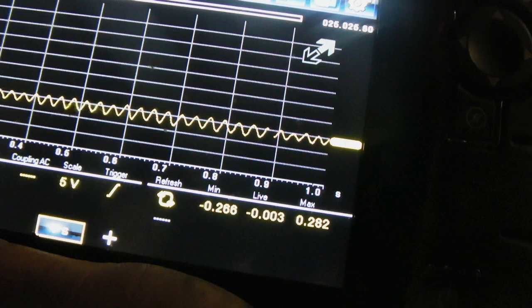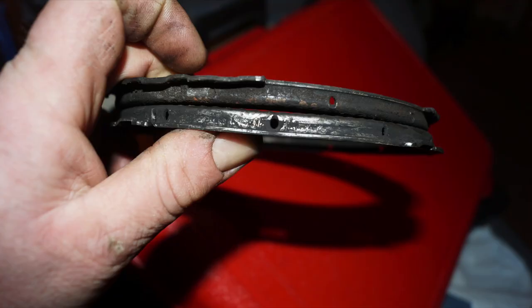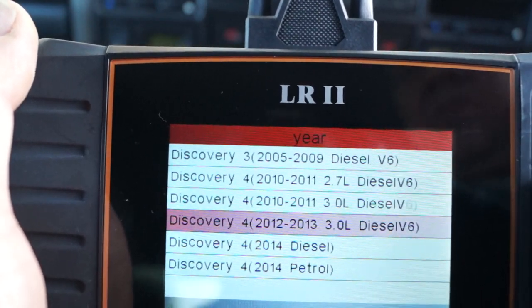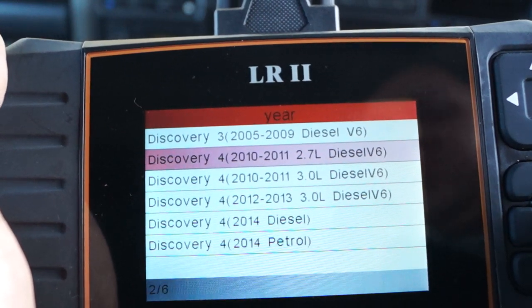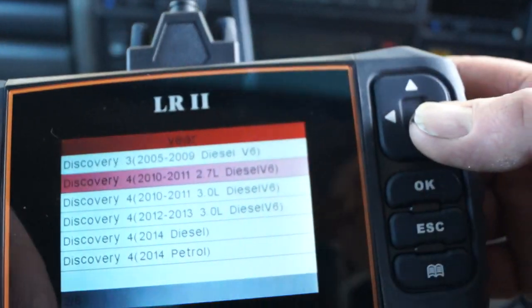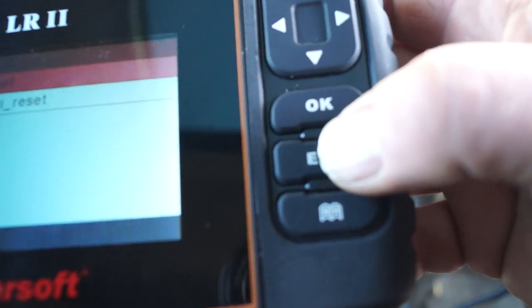What I'll have to do is show you the signal off a crankshaft sensor, and then you'll start to understand that this is now the norm for diagnostics — or front door diagnostics. I explained in the last video that if your exciter ring has a dent in it, you will actually lose the signal at a certain point, and that will come up with a fault code because the ECU can't see it — it's under a certain voltage — and you can see this very clearly in this picture here. Some of you have got your plug-in diagnostics tools, and yeah, you can do certain things on your vehicle.